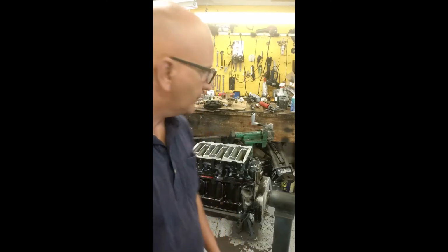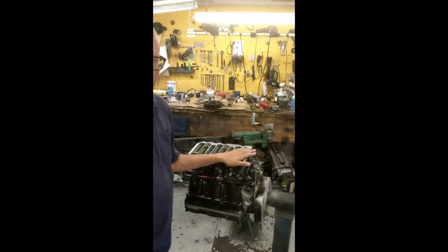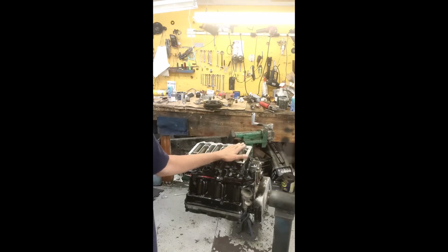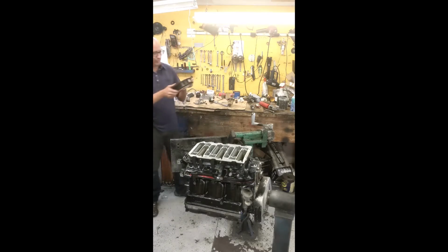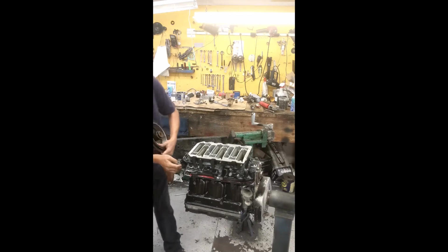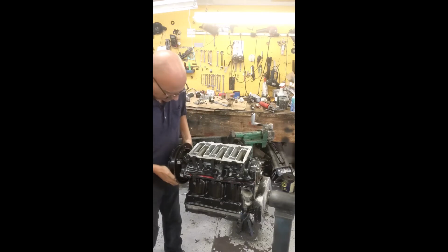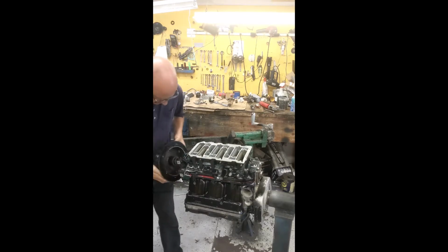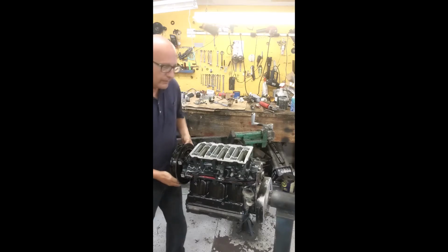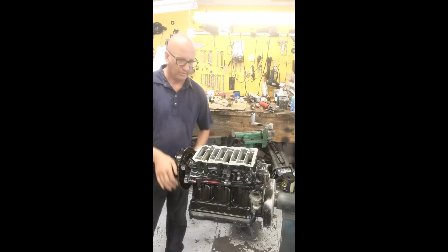As we say, the two halves are put together. Crankshaft now is tightly in place. After I do this and torque all the bolts in sequence using the book, we like to take the flywheel, put it on here, just make sure it turns over easily, and this does. No resistance, even all the way around.